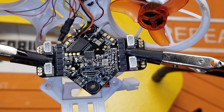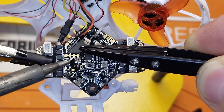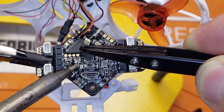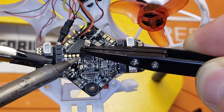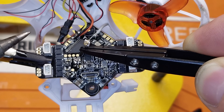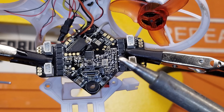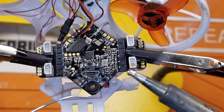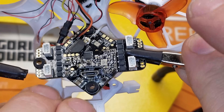I have to give it the old backhand routine here just because I want you guys to be able to see it. Alright, that's attached. That should be all the soldering we need to do. As always, take a hot iron, cover it with solder, and then turn it off — keeps that tip from oxidizing. Now we've got that taken care of. I'll go ahead and clean this up a little bit with some flux remover.